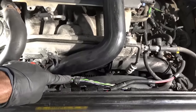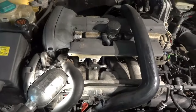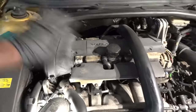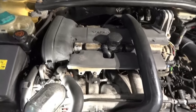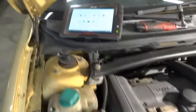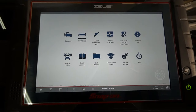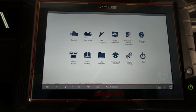This tells me we have a shorted fan module. I don't even have to look at the engine coolant temperature sensor reading on the scanner, because by disconnecting that one signal wire we just ruled out both the computer and the coolant temperature sensor. The next step I was going to do was disconnect the coolant temperature sensor, but we've already ruled that out. If some of you still have doubts, I will do that. Let me disconnect this main electrical connector just to stop this cooling fan noise.